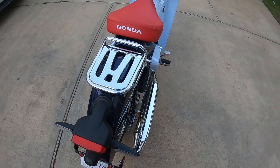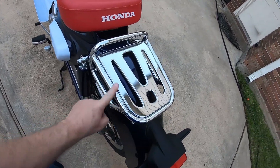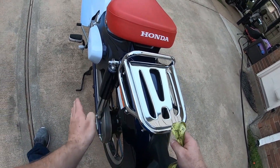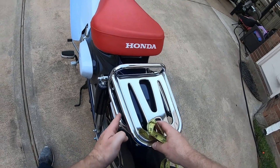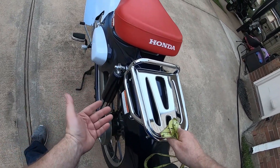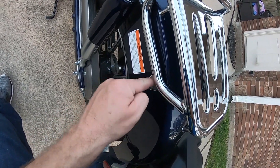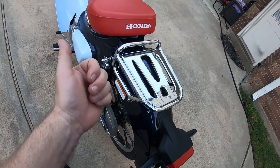I still have to finish bleeping all my swearing — I was really upset when I put this on a couple nights ago. This ear right here was very bent. It was the welding jig they used to produce it that was way off — at least a quarter of an inch inward and also tilted in at the leading edge, so it was biting into the plastic. There was no way to make it fit without seriously beating it into submission, which is what I ended up doing — not before it gouged my paint here, all the way down to the base plastic. It just sheared it off.